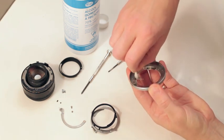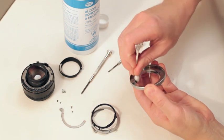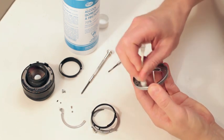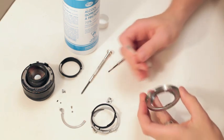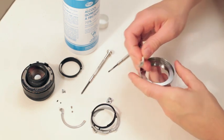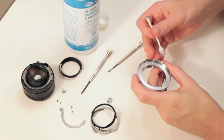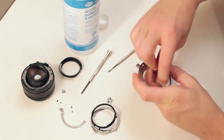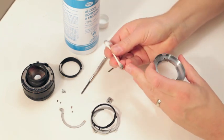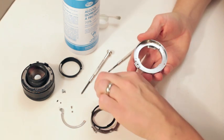So I'm just going around in here. Let me dry it out. The 50 1.8 gets it quite often, and the 55 1.2 as well — basically almost every one. I'm going to take this out as well. This metal is really well-built. I don't know how much they need all this grease in here. Leave some in there — I just want it away from the rim so it doesn't keep leaking in. That's it. You can see, look how black that is. That's all it was — just over time, grit and nasty oil.